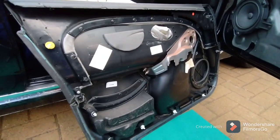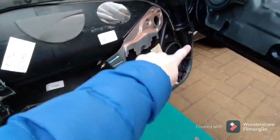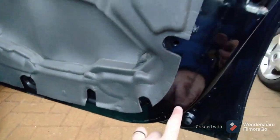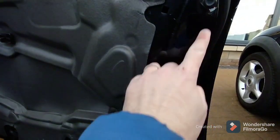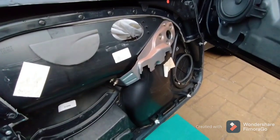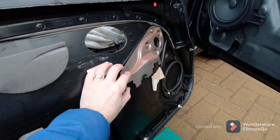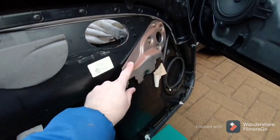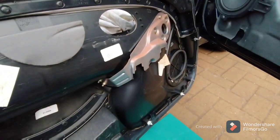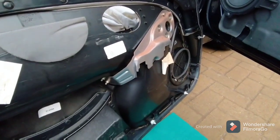The door card comes off — just pop off these clips with a big screwdriver, they fit in just around there. Somebody's been in here before me, which is good because I didn't worry too much about putting the odd wee scrape on it. The Haynes manual and pretty much everywhere else online — nobody seems to know how to get this. There's a big massive centre clip here that holds it onto the frame of the door for the door handle on the other side. The Haynes manual basically says pull the clips off and you'll probably break them and have to replace them.